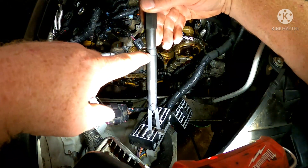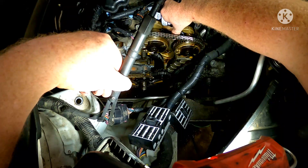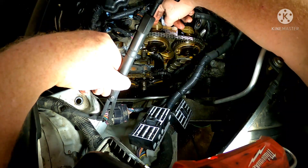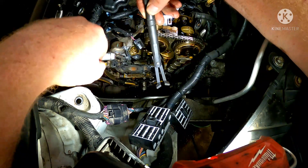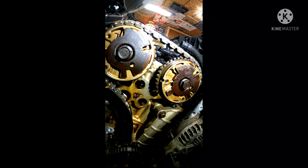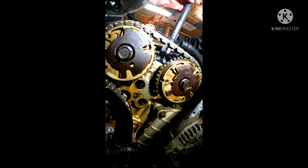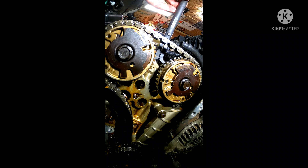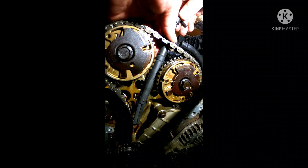They make this tool to take up the tension in the chain and give you a little bit of slack. These two marks here are your approximate location when you install it — the top of this block that holds the front cam bearings. When you install it, you want the top of that piece of aluminum to fall within there approximately. You're going to start twisting and it'll expand.